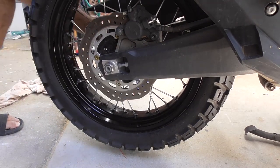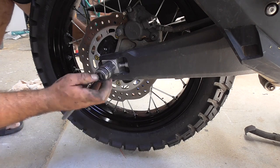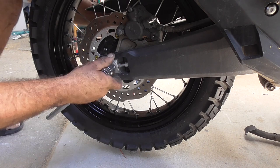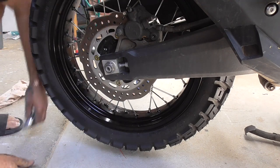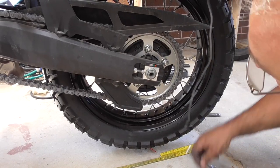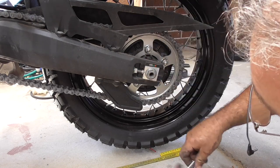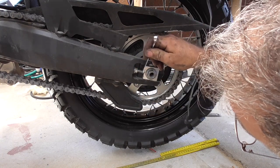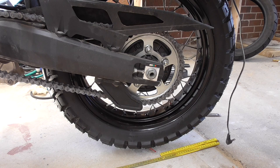I've got the shifter on the other side just to hold it - not going to tighten it all the way up yet. Just going to nip it up to make sure that the shaft is straight. Then we'll get the - I think it's a 14mm spanner. So I'm going to adjust these now and get the tension on the chain. It's a 13mm spanner to crack that, and then I'm going to do one and a half turns on each side. Might be just about right.